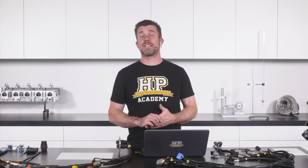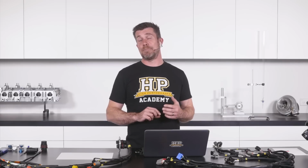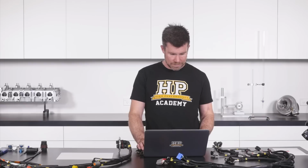Dealing with my network of contacts in New Zealand, I found out who another race car builder here in New Zealand that I trust was using for drive shafts, a company in the North Island of New Zealand. Sent the drive shaft up there. They checked the balance on the existing shaft and found it was out by a massive 20 grams. So at this point, we've had them rebalance our initial drive shaft. We've got it back in the car. Obviously, we're going to be crossing our fingers and hoping on Friday that when we get out to test, the high-speed vibration has gone.